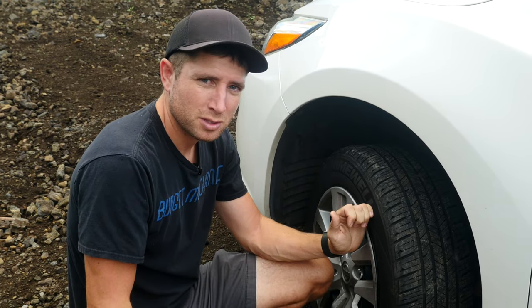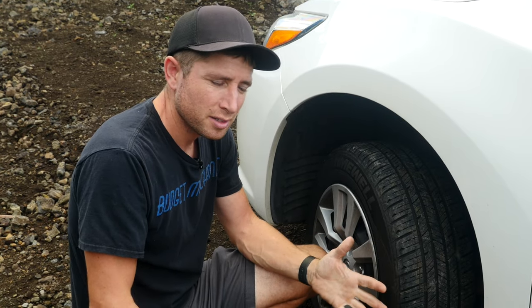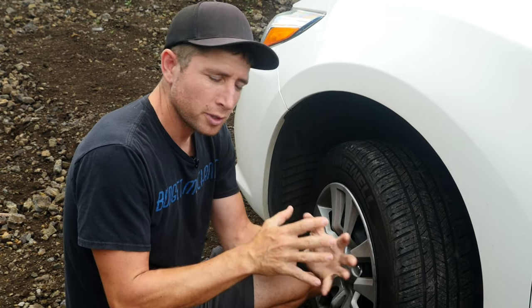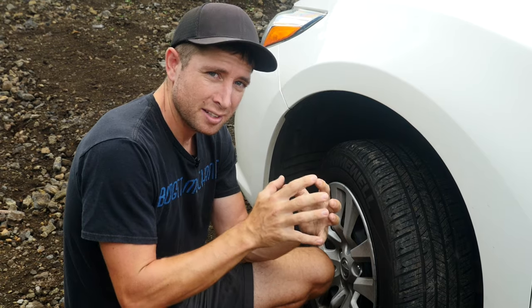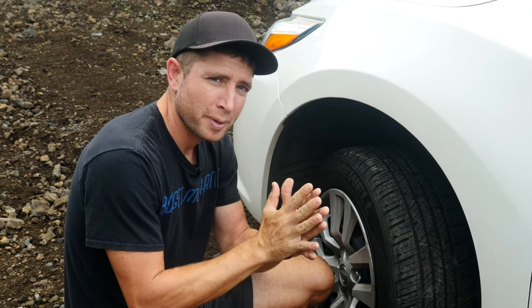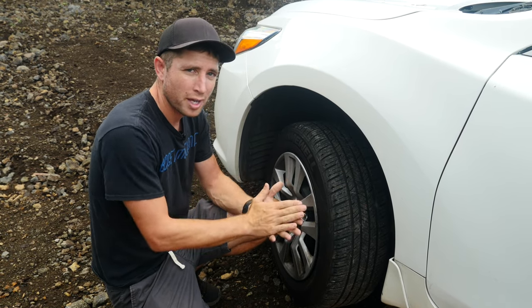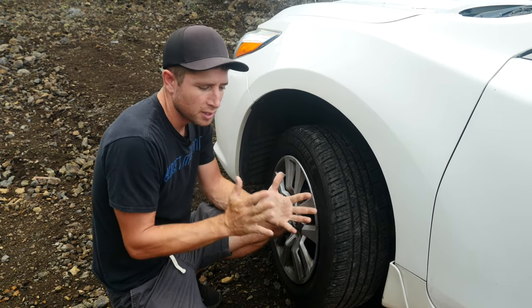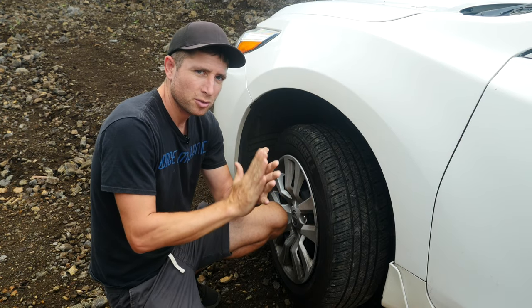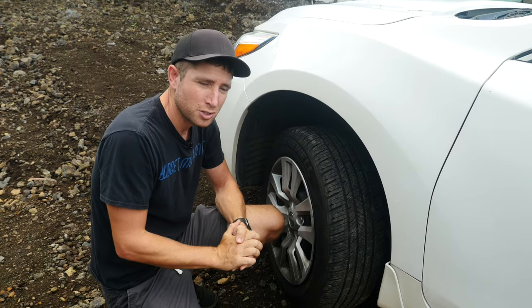I think glazing might be what's happening here. The reason it's only showing up when the brakes get hot is because the brake fluid and all the metal parts, when they heat up, expand and your tolerances get smaller, so things start rubbing harder together. The reason the sound will sometimes go away when you press the brake pedal is because they're lightly rubbing when you're not pressing, and when you hit the brake they get forced together and that sound will often change.